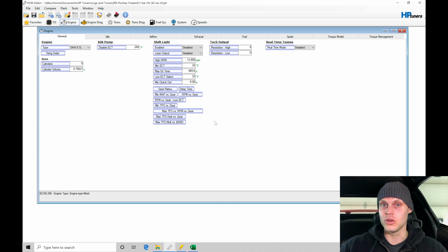So we're on day 2, so I've let the vehicle sit overnight. We're ready to check the cold starting, making sure that it fires up and it runs properly. We want to see when it fires off what the air fuel is going to do. For the first maybe 30 seconds, minute, 2 minutes of running, it's not going to go into closed loop. It's going to run at a richer air fuel.